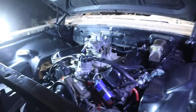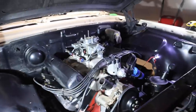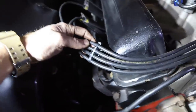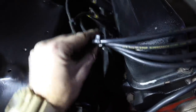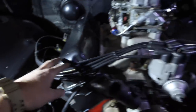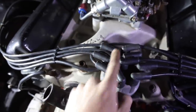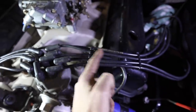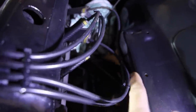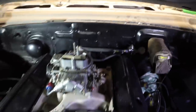We're about finished up on the Galaxy for today. I'm pretty stoked with the progress — the engine bay looks really, really good and it's really promising. All I need to do is wire some stuff up, throw the radiator back in — which will only take about an hour — and then everything will work the way it should. I loomed up the spark plug wires with a trick: use zip ties, throw one around all four, put one in between each, flip them around the bottom. They look really pretty and symmetrical from each side. You also want to wire them through each other correctly so they line up perfectly. The coil wire comes off here and splits, with a zip tie at the bottom to hold them together, then two separate looms.